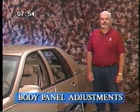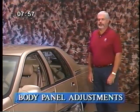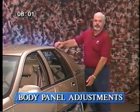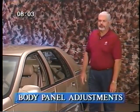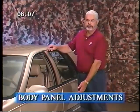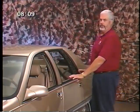If a door adjustment is necessary, first of all, look at the rear door in relation to the quarter panel to maintain the perimeters of a 4 to 6 millimeter gap. Once that's established, then we look at the front door to rear door relationship, maintain the same perimeters. Once the two are coordinated with the right perimeters, it makes the installation of the fender much easier with the proper gap.